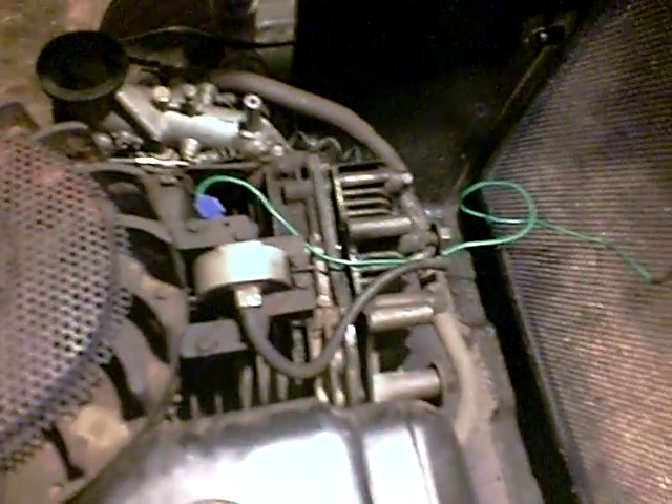Make sure the battery is grounded onto the frame. Now, the green wire — I just tied it into the kill switch wire. See the little kill switch wire right here? Just coming in down here and bolting down there, below your throttle mechanism — the original throttle mechanism plate. Just a little wire that goes underneath your coil; just a little kill wire. Every coil should have one. This came in the kit when I bought it, so I just tie it into the wire and that's it, and it works.